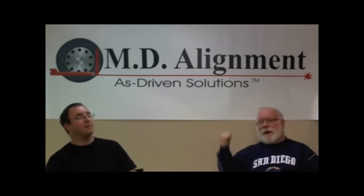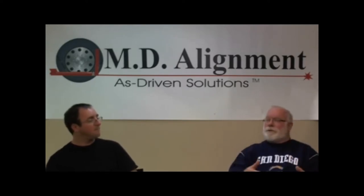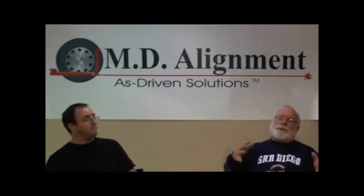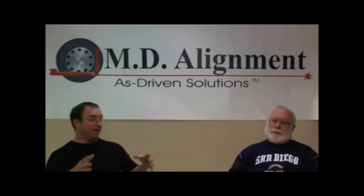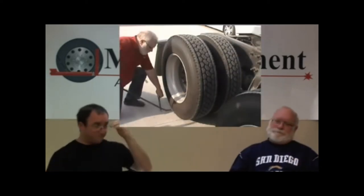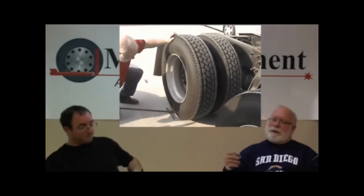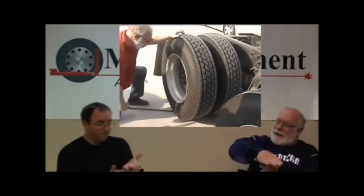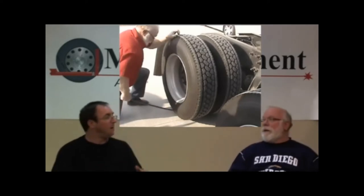If I go back to a drive or a trailer axle, with two tires, rims, drum, hub, I've got 500 pounds of weight hanging on it. When I jack up the one side, that 500 pounds of weight loads down on it, sitting down on a much larger bearing now. And as old as I am, it's getting harder and harder for me to wiggle that and find anything. So what I do is I take a tire iron, and I slip the tire iron under the tire, and I put a socket down as a fulcrum to use as a lever, and then I can push on the top of the tire iron, and I'll find the problem.